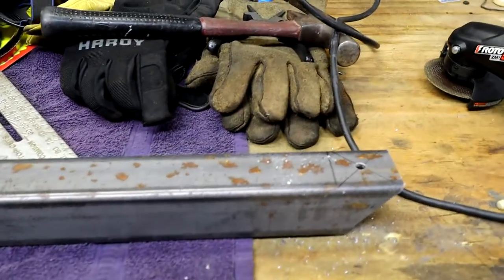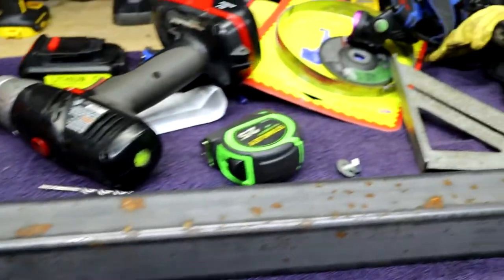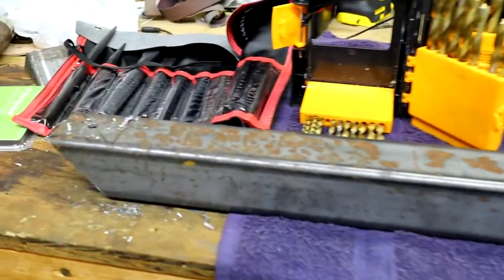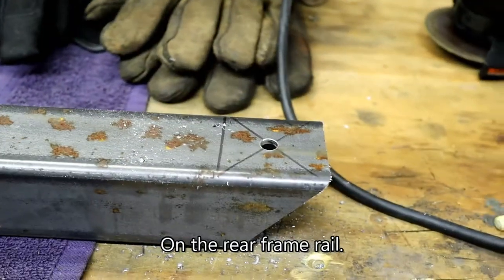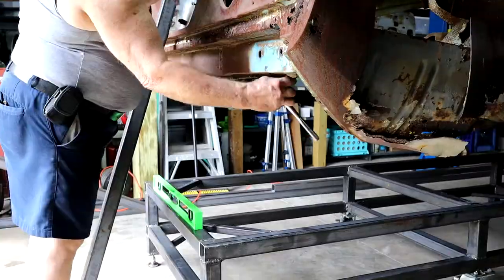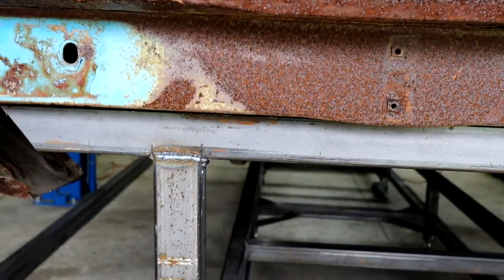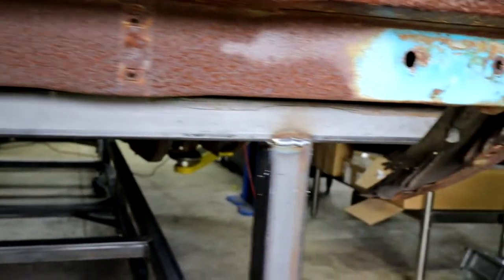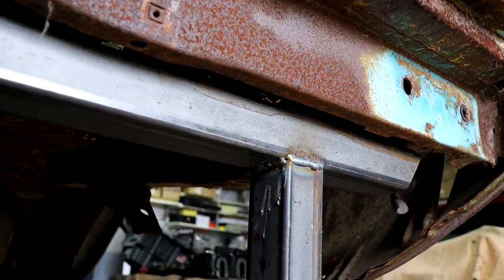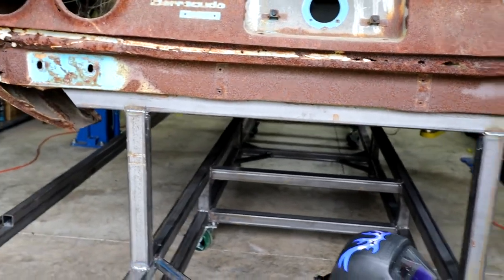To put our braces on the back of the car, we have cut this beam. This is going to go where the rear leaf shackle goes — the second-to-last bolt right above the bushing back there. This is exactly 50 inches long. We're going to mount bolt here and bolt here on the sides, and then run the square tube up to that — that'll take care of the very back support. We now have the rear section in place, welded on the corners. My welds on the angles still need a little work but my flats are pretty good. That is now bolted in place and the rear section is set.